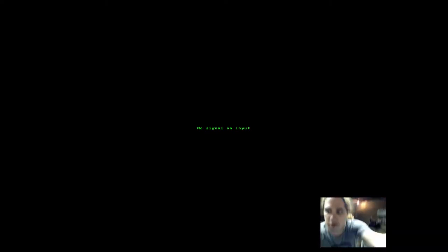So some changes were made to the computer. When I tried to plug it in the first time, it didn't boot. I kind of freaked out a little bit and realized that the video card wasn't installed all the way. So I took the video card out, put it back in, and it booted. I also had to take out the hard drive. I thought this BIOS could read the hard drive, but it couldn't. So we're back to using the compact flash adapter, which as of right now is not actually connected to one of the expansion sockets. Well, it's plugged in, it's just loose now. Once everything works, I'll put that back in how it should be.